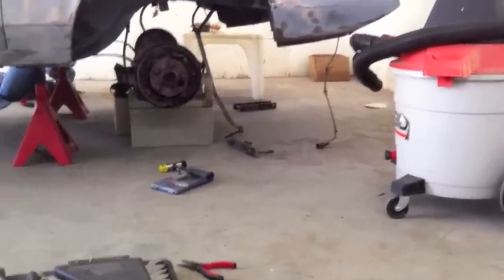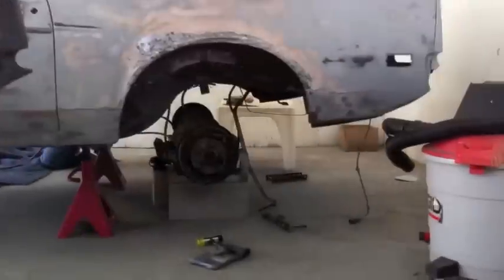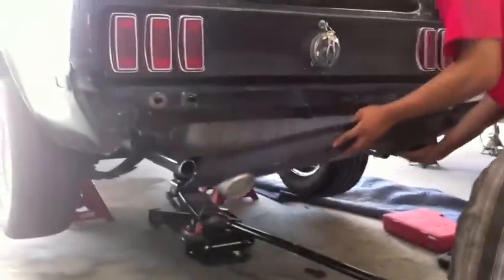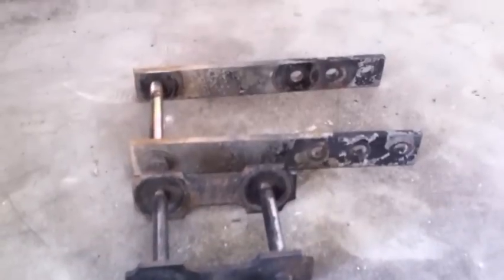And then we're going to take a road trip with Michael to AutoZone. Michael's over there cranking on the 71 — thank you, Michael. There he is. We are trying to make a decision on cutting this shackle; I don't think we should. Why don't you put that on there, Rick, and let's look at how much sticks out from the back. That's the old Mustang shackle and that's the new one going on. He only wants an inch and a half lift, so the first hole is an inch and a half lift. We're going to cut these last two off so they're not visible and it gives him the lift he wants on the tail end.